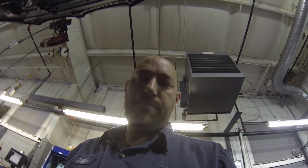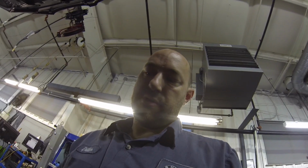So now we're going to put the top back together, time it up, see how it runs. Originally this car was towed in, would not start because the cam timing is so far out. It just won't start. So usually a pretty telltale sign the Vanos is broken. You crank it and it's funny, you get a weird compression type sound. It doesn't sound normal.